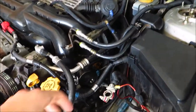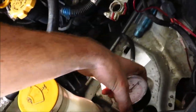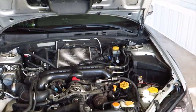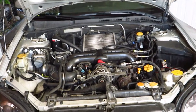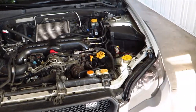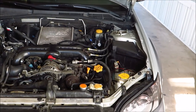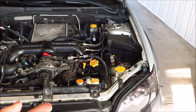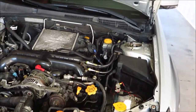Car's cold, we're going to try it again. As you can tell, I already cleared it, but the compression was now 90 PSI. So what's supposed to happen is you do a hot test and get a higher number, then a cold test that's 10% lower — meaning bad rings. But the compression was 50 before, I drove the car and felt it driving better, and now it's 85 hot and 90 cold.